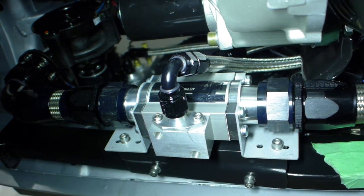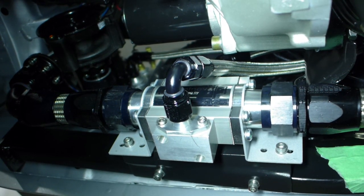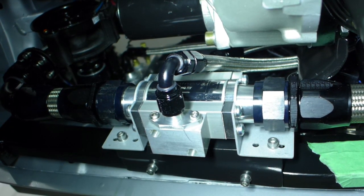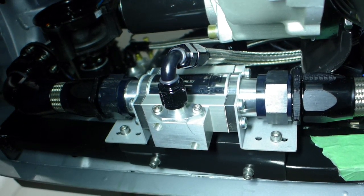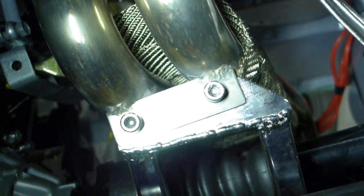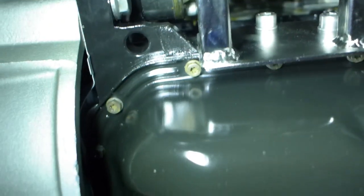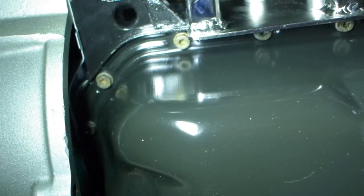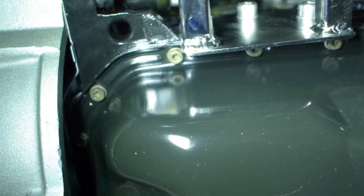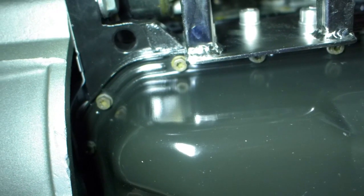This is back in now. The brackets have been moved to the outside, re-zinc plated, and everything is cinched up - hopefully it's not going to leak. I also had this brace to the header that I thought was creating seepage around the oil pan gasket, but I've re-tightened all the oil pan bolts and I think that's all it needed. Hopefully this is the end of the leaks.